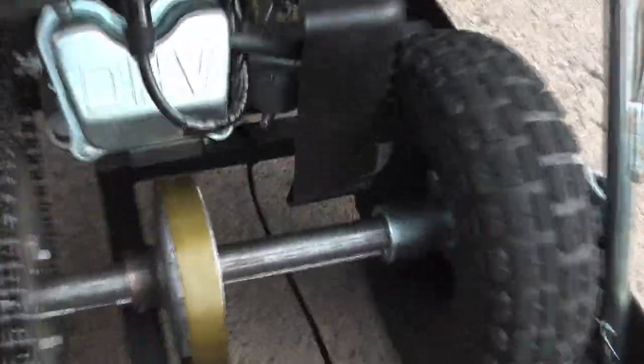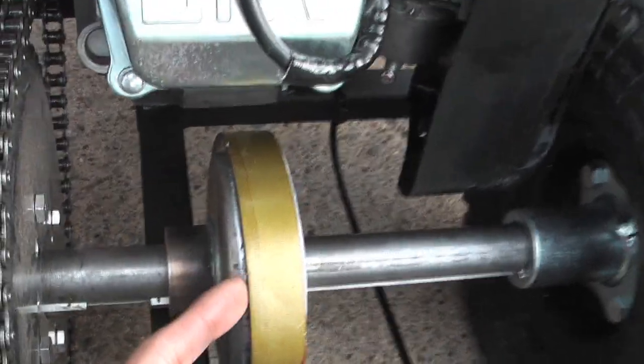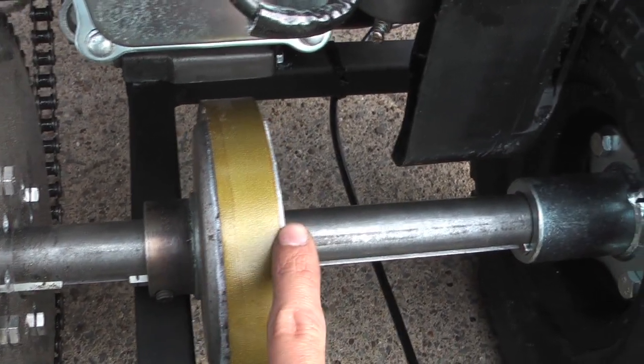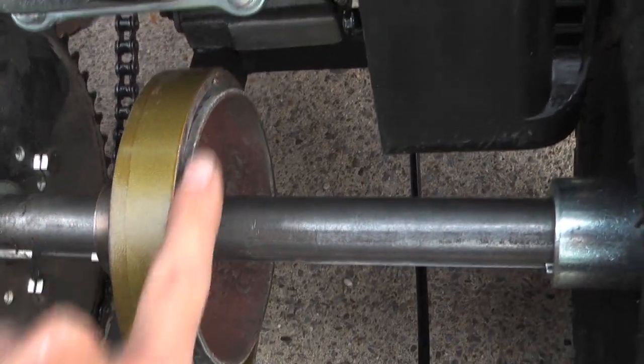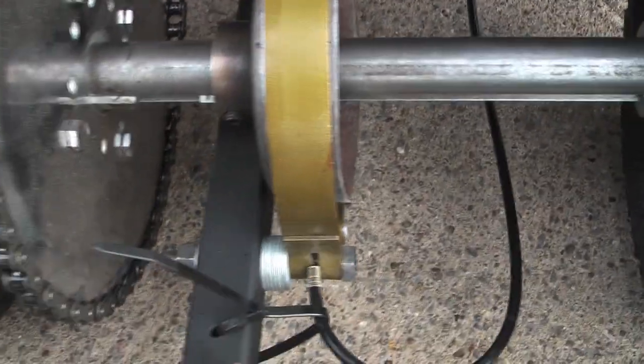And I also found that I taped it, but the brakes were wearing, the drum had a divot in the middle, so this edge and this edge were raised up. I don't think I showed that, but I hit the drum with a flap wheel to try to even it out. And so hopefully we'll get a little bit better braking.